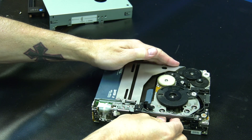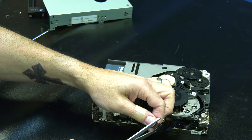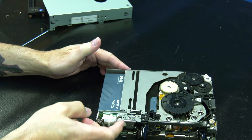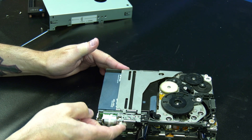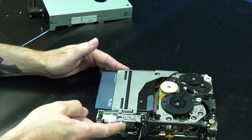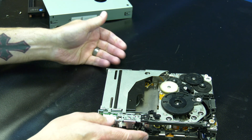If you decided you want to cut the tape on the drive, please pull out some slack carefully and use a pair of scissors to cut the tape media. Then locate the gear on the front right side of the drive. Rotate the gear upwards repeatedly to raise the deck up and push the tape cartridge outwards. Continue to rotate the gear until it will not go any further. This will ensure that the cartridge is fully pushed out. You can then remove the tape cartridge from the drive.